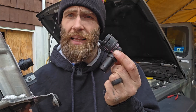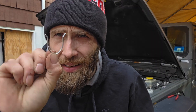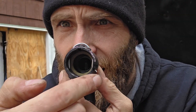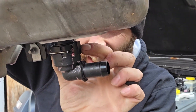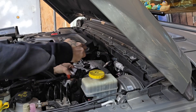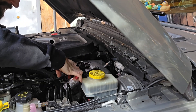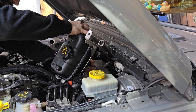We have our new coolant bottle put onto our bracket. We just have to decide how we want to put this elbow on. I like to put the elbow in the Jeep first because that hose clamp is harder than this little clip. I lost my little clip, so I had to make a new one out of a stretched-out cotter pin. Really all this little clip does is go on this elbow and then the wires stick into the side so that when you put the bottle on, it clicks and won't come out. I highly recommend you don't lose yours, but if you do, it's not hard to make a new one — otherwise you'd have to buy the whole elbow, which is probably 40 bucks. Put the elbow into the Jeep first, make sure your clip is in and seated, then slide the reservoir on, clip it in, give it a good tug to make sure it's not going to come off.